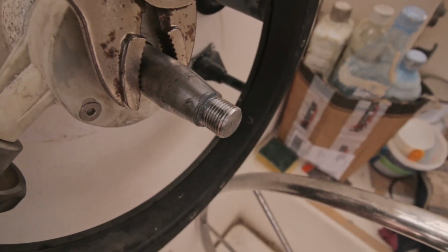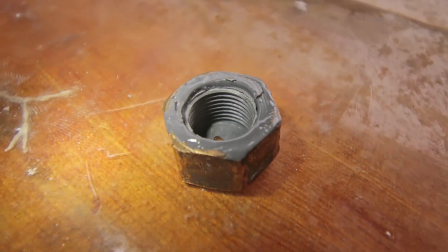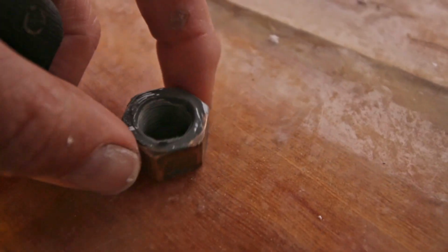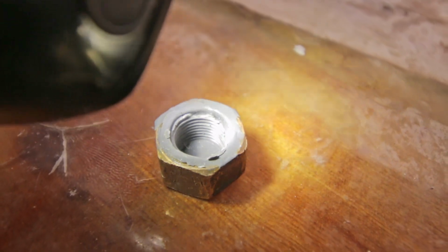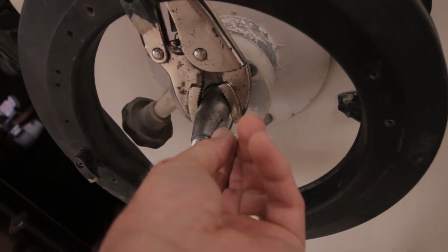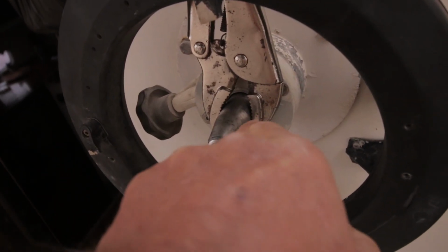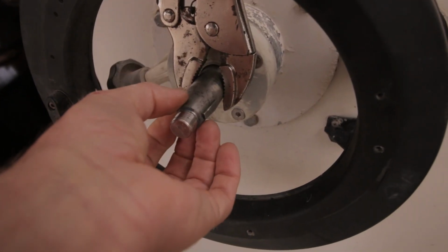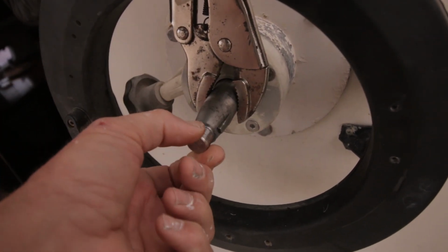Ooh. As you can see, the thread is clean. There's no epoxy stuck in the thread. And here neither, see? Beautiful thread. Thing is though, on this side there was not enough epoxy, just a little bit. And actually this nut only serves to keep the wheel on the shaft. Because the power that you put on the steering wheel is a radial force. The radial force of the steering wheel will be transferred to this spline, and the steering wheel is also pressed on this conical part. So all the forces are here and not on the nut.